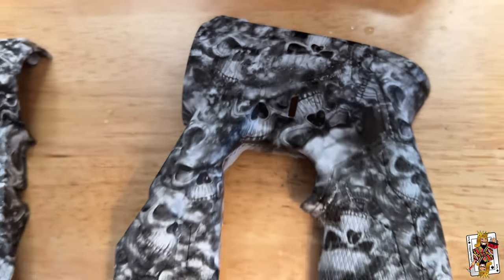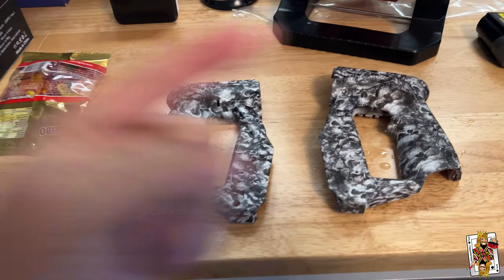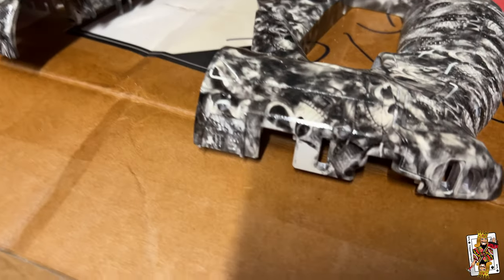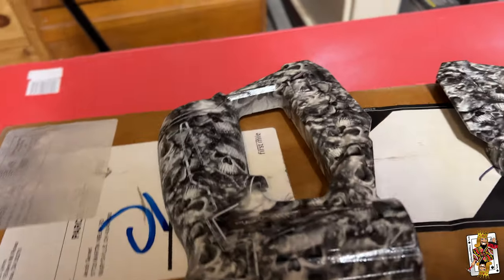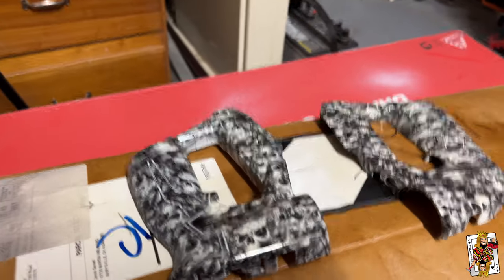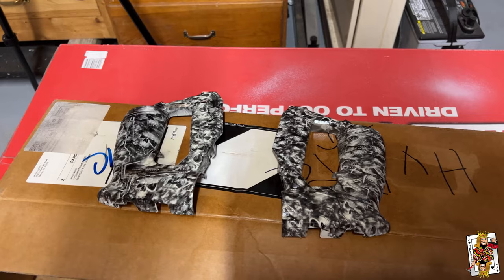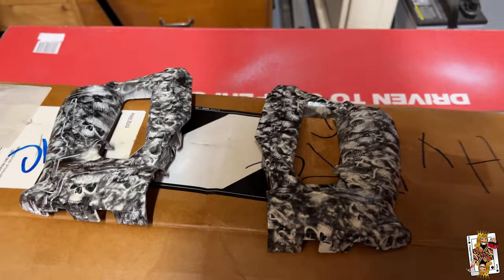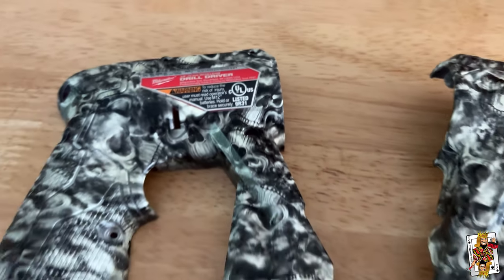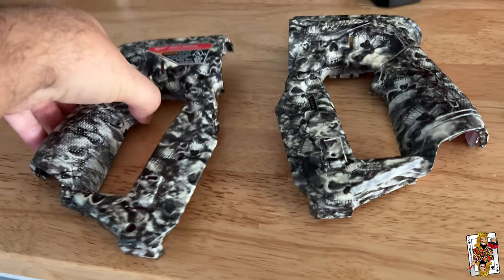Oh, look at that — it doesn't have the clear on it yet. It's going to get a matte clear, and I'm using a Milwaukee fan to dry it. We'll be right back once these get peeled and cleared. Second coat of super matte clear just went on — that's why you can see some shine, but the fact that it's matte clear, it dries real quick. So far not having any issues with running, so that's awesome. Once it dries I lift it up and get under stuff, and in the areas that are a pain I set it down and put a good coat on it. I went ahead and put a fourth coat of clear on after I peeled the labels. I'd say it timed out pretty good, and now it's time to put it together.